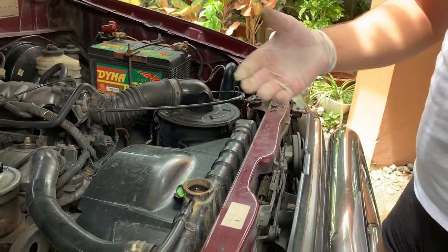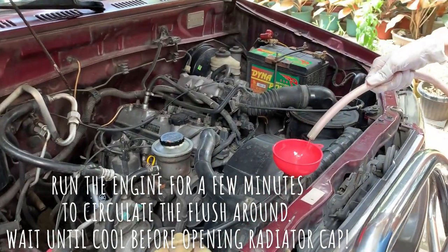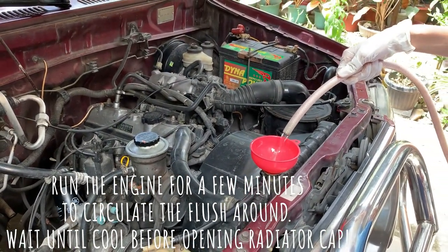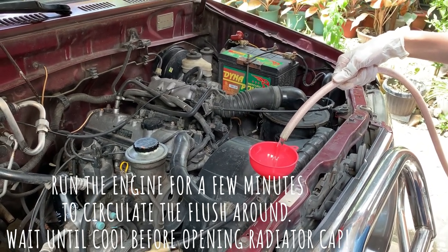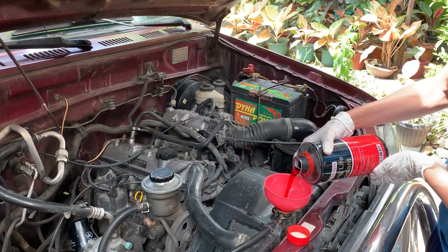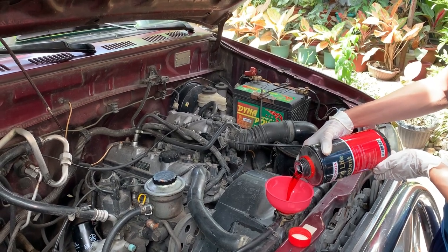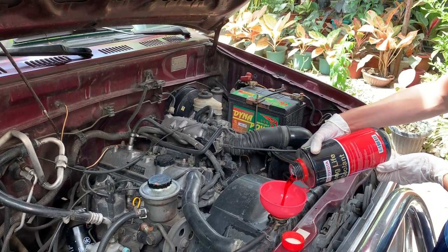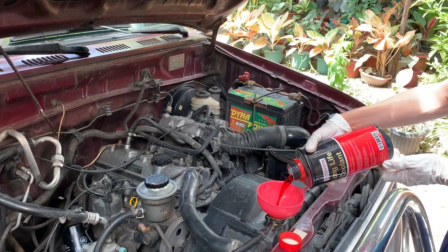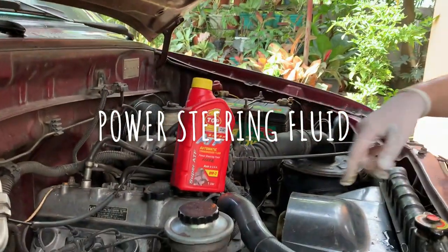The coolant that came out is very clear, so I'm just going to fill up with water, let that flush out, and then put our final mix in. We're filling up with some tap water first, filling to the top, then we'll rinse it all out. Then we're putting in some Toyota coolant. Get rid of the effluent safely. I'm going to do a 50/50 mixture — six liters capacity, so about three liters of this long-life coolant and three liters of distilled water.